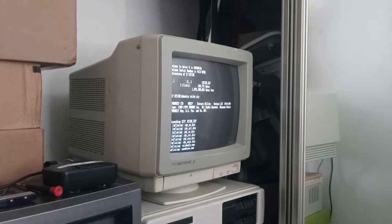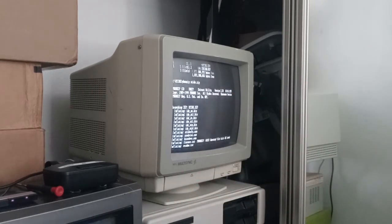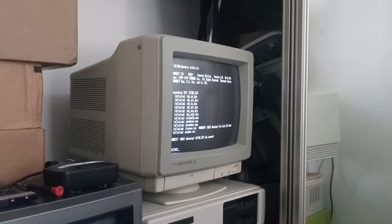We're going to take all this off and take the monitor off. I'll be doing most of the work from my television. And then we're going to check the jumper settings on the card. We're going to set it so it's flashable. I'm probably going to mark that thing with a special color too so I can see it. Then we're going to flash the BIOS.